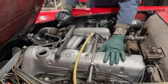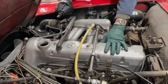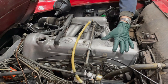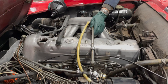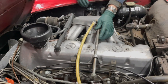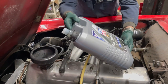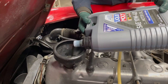The maximum oil capacity in the 280 SL is 6.5 liters. There's approximately half a liter in the oil cooler and about half a liter in the oil filter, so you're looking at around five and a half liters when doing a service. What I do is put five liters in first — I'm not going to film the whole operation here — but I'll start by putting five liters in the engine.